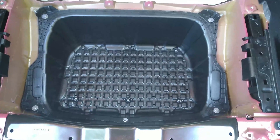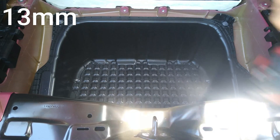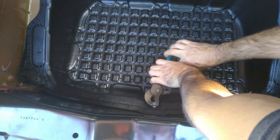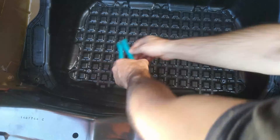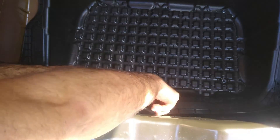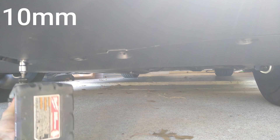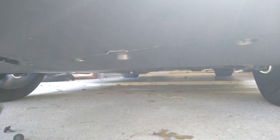I understand this tub needs to come out, which is not fun. Four very regular looking bolts here. One Torx bolt — say what? And then five reverse bolts. Let's start getting the 13 millimeter bolts here. And then riddle me this for this star type — can I just use a pair of channel locks? Maybe. Yeah, sure can. It's not on that tight. These are 10 millimeters. Let's see if we got the right ones out. I see an empty hole, empty hole, empty hole, empty hole, empty hole. That means we're ready. Now we're going to pull this tub out.